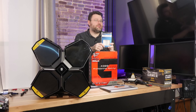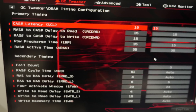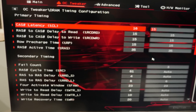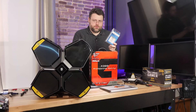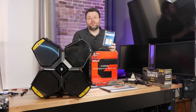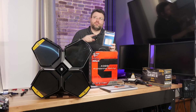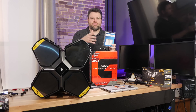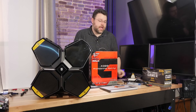We're going to save a screenshot of the BIOS from the x399 Fatality to show the timings in the video. And yes - did we verify that error correction is actually correcting errors? Yes. The error correction code in the Linux kernel is there, and also the hardware notification for single-bit errors and dual-bit catastrophic failure. All of that is in place.